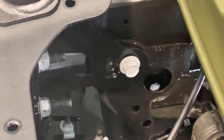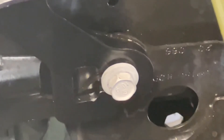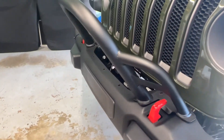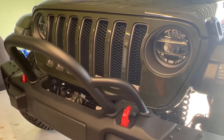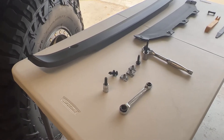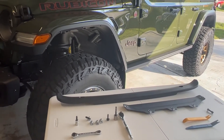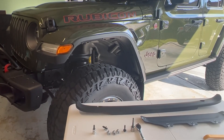This reinforcement bracket will have to be angled to where it's got a notch, and you push it all the way forward so that bolt goes to the back — that's a 16 millimeter socket. If this is all you're going to be doing, it's going to be a fairly easy install, but the nut clips are the challenge. Get yourself a bedspread, cover the grill, and take your time. That's about it for part one of the stinger bar and winch plate install — stay tuned and I'll have the next video out before Jeep Invasion.